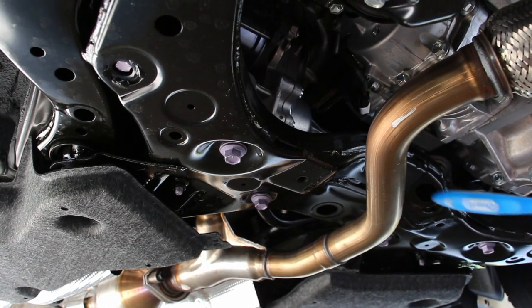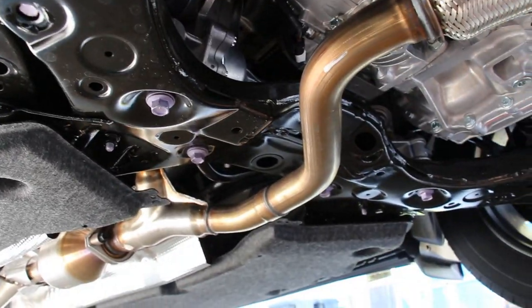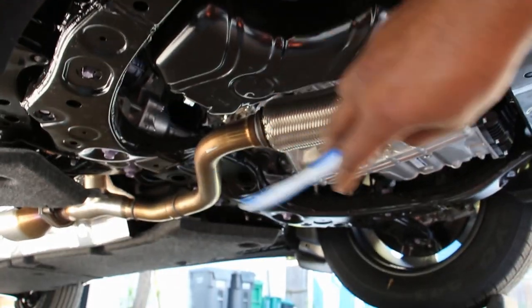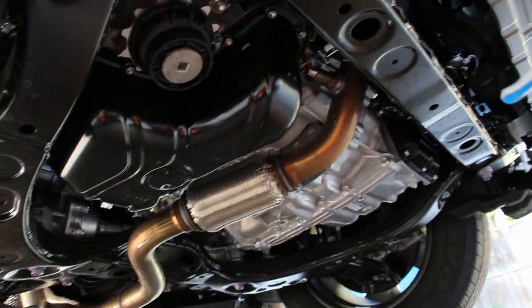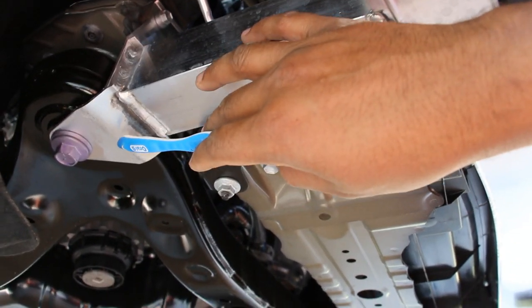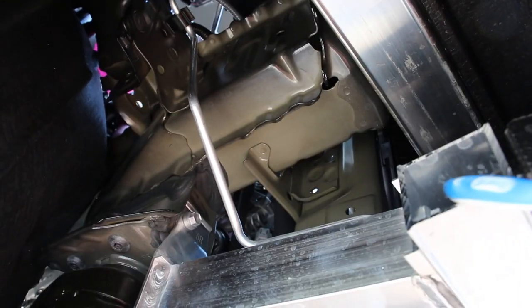Here's one thing I really appreciate about Toyota sticking to an old-school design. They've got a stamped steel front subframe that — unlike many newer vehicles — not only ties the control arms together over here and here, but extends back to the front all the way up to the front radiator support. So essentially you've still got a full box frame all the way around here that supports the engine, as opposed to just being chopped off right at the control arms with everything up front just being plastic. The lower radiator cradle is also made of steel and has an extension that comes off the subframe out to a lower bumper rebar — so you've actually got two separate bumper rebars protecting you.